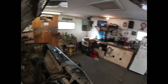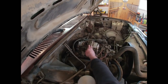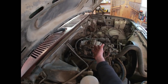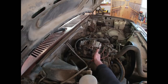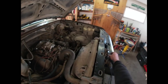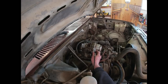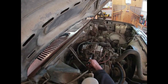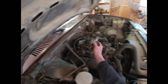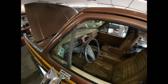It works, I ain't complaining. So basically what we're going to look for when I start it up is that that choke blade opens up just slightly enough to pass some air by so we're not building up all the vacuum underneath that choke blade. We want to note that we are going into high idle. We're also going to double-check voltage with our test light once the vehicle has started. Then we're going to confirm that as it's running and power is applied to the choke coil, the choke blade is slowly opening over about a two-minute period. Let's go ahead and fire it up.